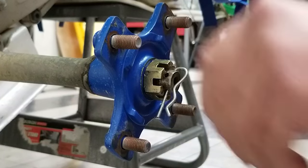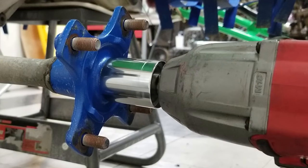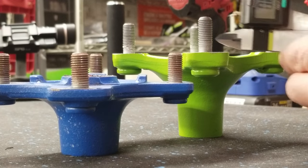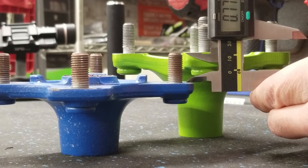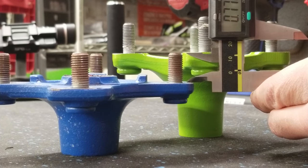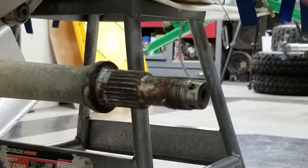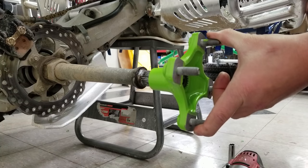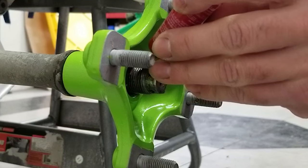Let's get the back wheels off and switch out the hubs. Get this cotter pin off, hold the rear brake and pop this loose. The hub slides right off. Before I put the green hubs on - you can see they're a little bit taller, looks like just about a little more than three-quarters of an inch taller, so that will actually add about an inch and a half to the overall width of the rear end. I'll put just a little bit of anti-seize on here before we put the new hub on so it comes off nice and easy. The new hub fits - no problem, perfect.